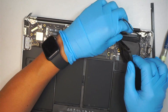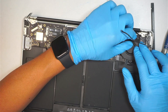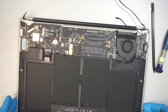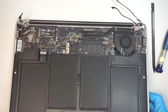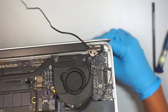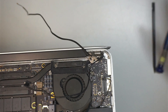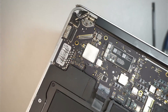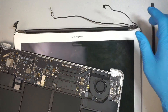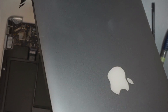Once you're done with that process, make sure all other cables are free. Open up your laptop to a 90-degree angle, pushing up the screen and the hinge, and slide the hinge out of the base. Once it slides out at a 90-degree angle, you will have the entire screen removed.